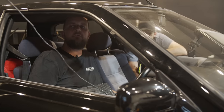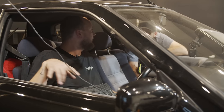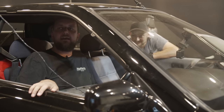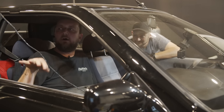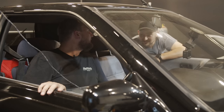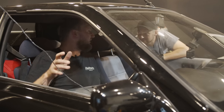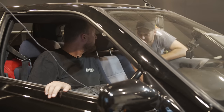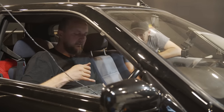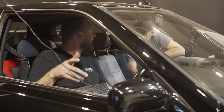The thing that's confusing us is the weird hump in the torque — the delivery to the rollers seems a bit funny. If that was nice and smooth, I'd say awesome. But I think there's a bit more investigation needed. That's the good thing about using a dyno — you can figure this stuff out because on the road you'd constantly be scratching your head and never know. Using the data logging is the magic.